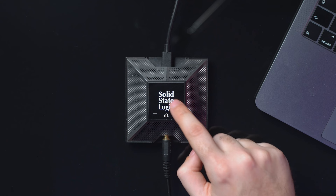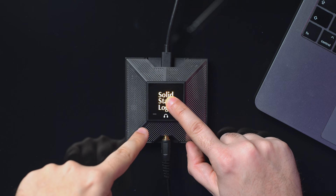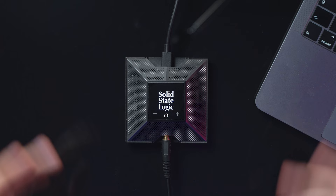Those are the four main modes. Let me switch back to Solo mode so you can hear me better. There is also a fifth mode called Immersive mode. To engage it, go to the setup menu and press and hold for five seconds. The SSL logo turns yellow, indicating that Immersive mode is now active. I can then switch to whatever mode I want, and now I have a separated output for each microphone — the main left and right overall output plus individual front mic, back mic, left mic, and right mic outputs.